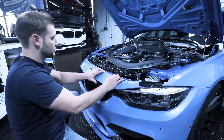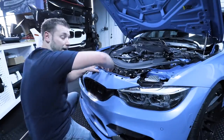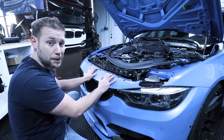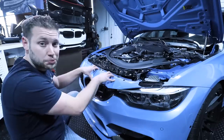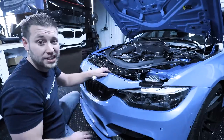Next, we're going to slide the bumper a little bit forward, then reach behind it and release the clips on the kidney grilles. BMW uses a polypropylene bumper, which is extremely flexible and durable, so don't worry — by pulling it up, you're not going to bend it out of shape or break it. It'll be just fine.